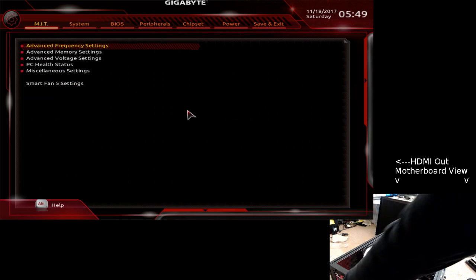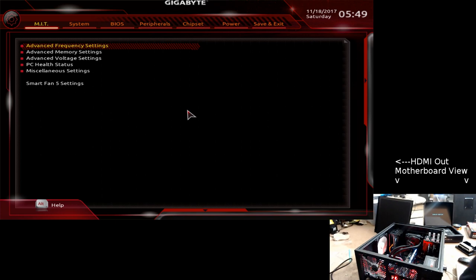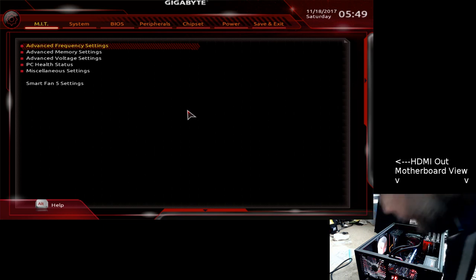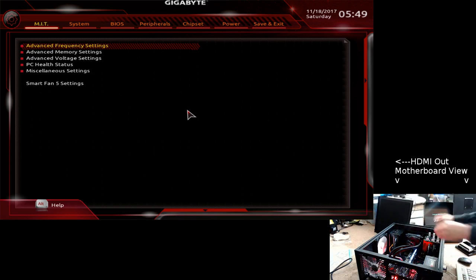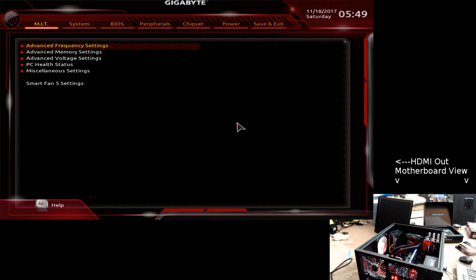I'm going to try moving. Wish I had a couple more cameras hooked up, but I just grabbed one real quick. So, plugging this USB header into the case USB. Oh, and now it's working. So F2 apparently has issues with initializing the USB headers on this board.